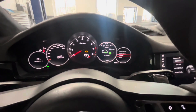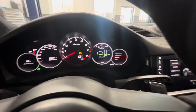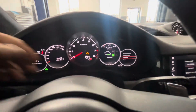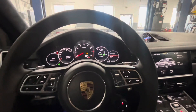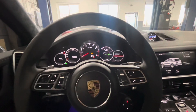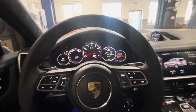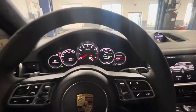So this one needs some oil. You can see it's moving up a little bit, which is kind of interesting — it is a live reading. It does that so all of your oil returns back to the sump. If it registered the reading right away after you shut it off, not all of your oil would be returned 100% to the oil pan yet, so the reading wouldn't be accurate.